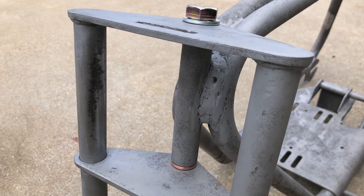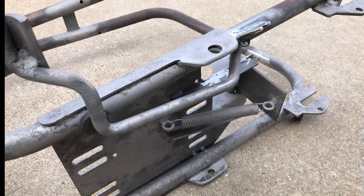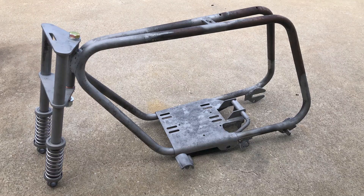As far as the rest of the frame goes, it was in pretty good shape. There were a few things that were bent that he straightened out — on the back there was a chain tensioner tab that was bent in; he bent it back out and added another one on the other side. It also didn't have a kickstand, so he added that for me as well. One of the holes where the foot pegs go was pretty damaged — he welded it and added some metal to it and rounded it out so I'll be able to add foot pegs.